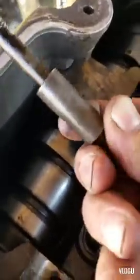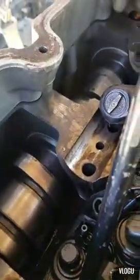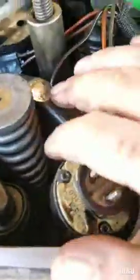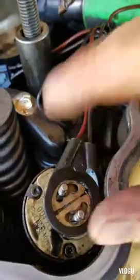There's your spacer, so just be careful with it. Now you can take a heel bar like this, drop it down just under the injector hold-down and just pop — pull up. Take note: this one doesn't have it because it's been taken off, but there's usually a plastic piece with two nuts on it. Pull both nuts off, it comes off just like that, then pull up.